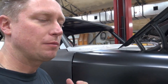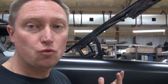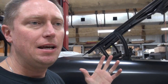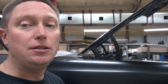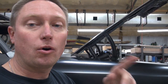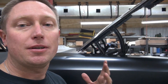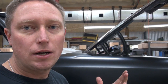Fun fact about these carbon fiber hoods, they are not near as heavy as the original steel hood, nor are they as strong. One of the things I recently did was I ordered some Eddy Motorsports hinges for my car. I wanted to do away with these old rickety hinges, and I came to find that the Eddy Motorsports hinges actually have a gas strut, and you specify when you place your order whether you are running a steel hood or a fiberglass / carbon fiber hood. And if you opt for the fiberglass / carbon fiber hood, as I obviously did, they're going to send you a set of hinges that actually have a weaker gas strut built into them.